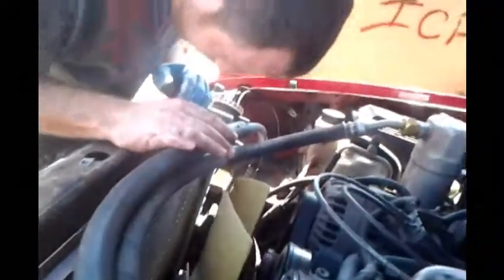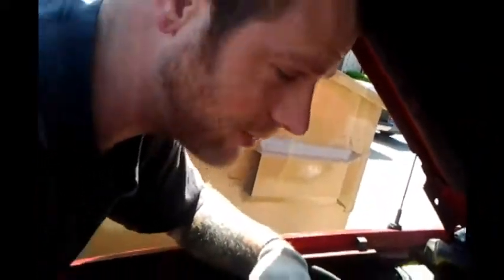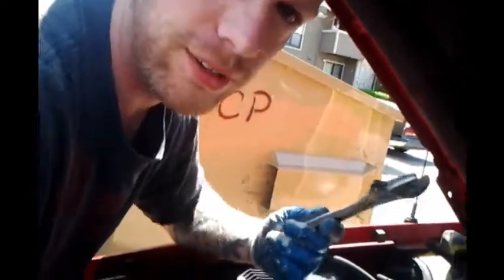Okay, we've got just that one connection. So this is what we did to our heater core — we took a Dremel and cut it in half instead of going in through the dash. We found our water damage. All you got to do is look down in there. And if you don't want to replace the heater core, which costs out the ass, just bypass it. That's all you got to do.